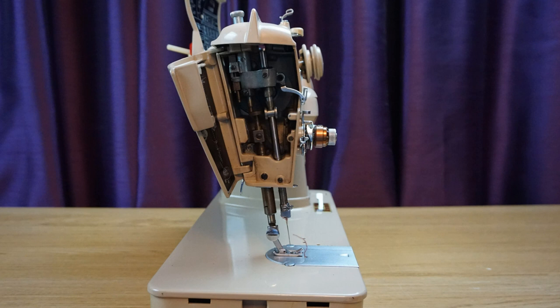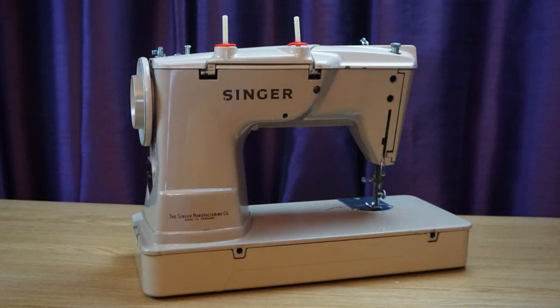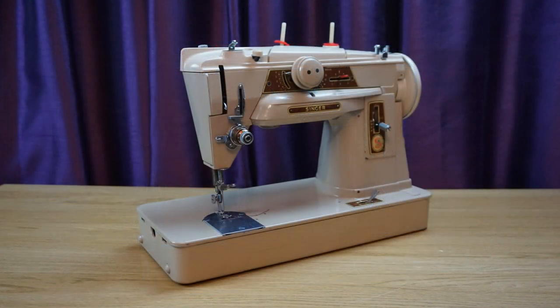The needle bar is angled at approximately 9 degrees. Angled any further and the needle would be prone to deflecting off the fabric, creating poor stitches and an increased chance of needle breakage. The machine is cast aluminium with a built-in direct drive motor and is completely gear driven with a full rotary hook mechanism, just like the 201.